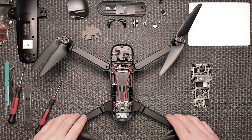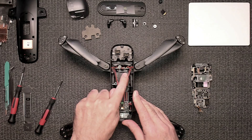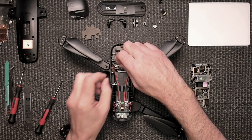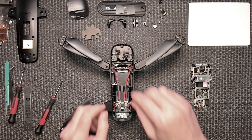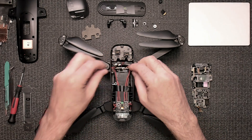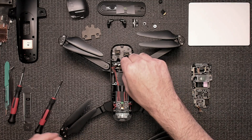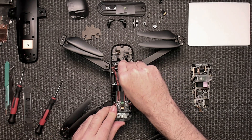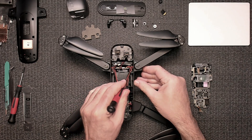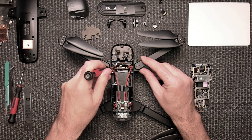Just to show you — the next video will be how to install legs, but I just want to show you this right here. This is your fan, and then there's a board here. You've got to be very careful because you can easily pull these wires out of the fan, so make sure you unplug this first. Then this board takes a little bit of work to get out — it's just sitting in some grooves, it just slides in. First try wiggling it a little bit, and if it does not come out, then use a tool. Push wires aside because they'll hold it kind of snug — sometimes they're wedged in and in the way.